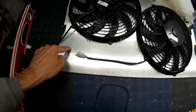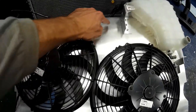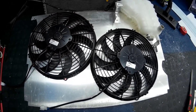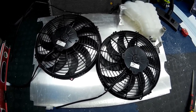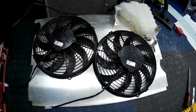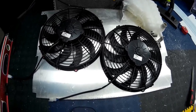We're also going to be putting some speed flaps in — one here and one at the top — which will allow air to escape through the shroud whilst travelling at motorway speeds and cruising around town. This also helps prevent the fans being on all the time, as it allows hot air to escape through the radiator into the engine bay and therefore cools the water.